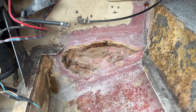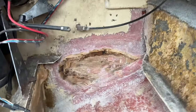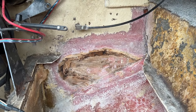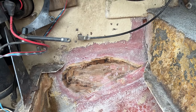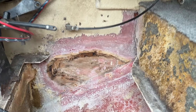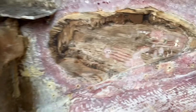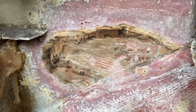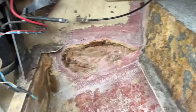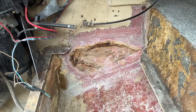Thankfully, Jack came over and was able to help me dish all of this out and show me the proper way of repairing it. I've been soaking it down with acetone — we're going to do that throughout the week and try to get as much moisture out as we can. And then we'll be mixing up some cabosil, laying that down, layering up some glass, and we'll probably end up putting wooden dowels in all of the holes. Every single hole you see, we'll probably get a resin-soaked wooden dowel in it — knock them in, knock them flush, sand them flush, and then chase them with some cabosil and fiberglass.